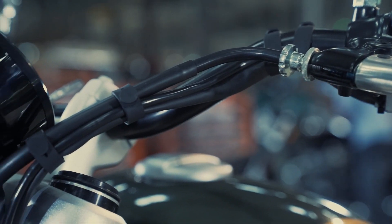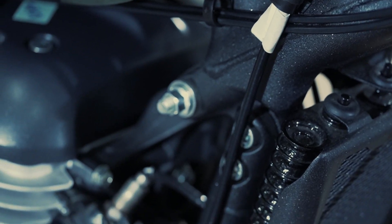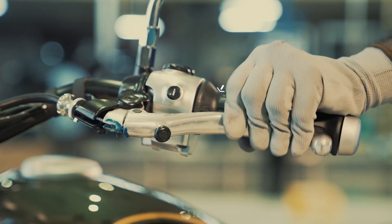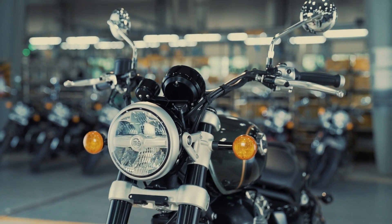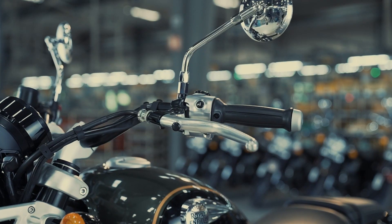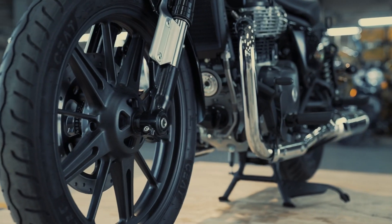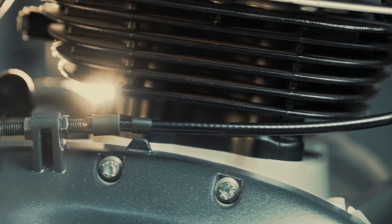There are a few important things to remember. Routing of the clutch cable is very important to ensure vehicle performance. Ensure free movement and no stickiness of the inner cable in the cable sleeve. Always replace the clutch cable as per the maintenance schedule for optimal performance. Remember not to wash or use any solvent for the inner cable. Always ensure that the motorcycle is in an upright position to ensure proper routing.